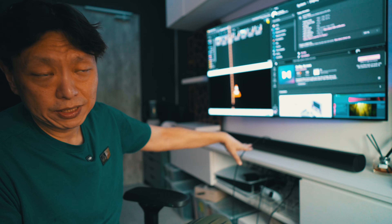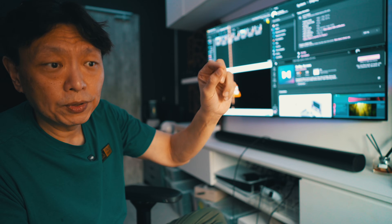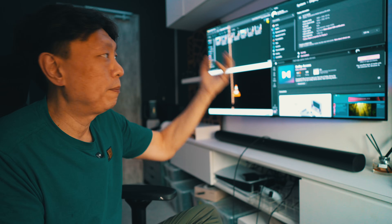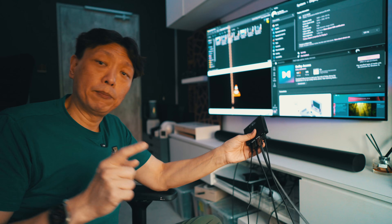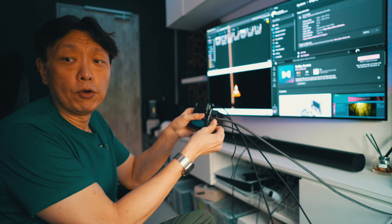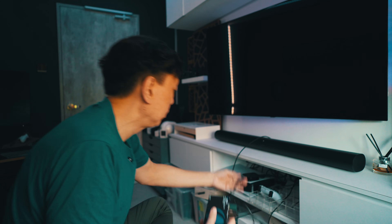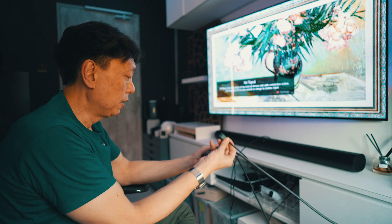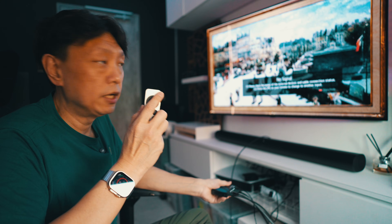So on this screen I've shown it works when connecting from a PC to a screen and outputting sound to the soundbar. But if you don't have ARC or eARC support, this is the way to connect it. Now I'm going to show another example, because not all of you are connecting a PC. What if I connect an output from my Apple TV? This Ugreen HDMI cable is connected to my Apple TV - I'm going to plug it in and turn it on.